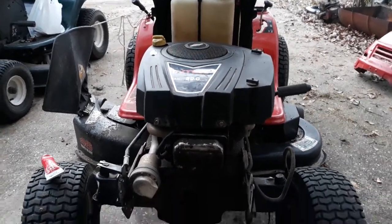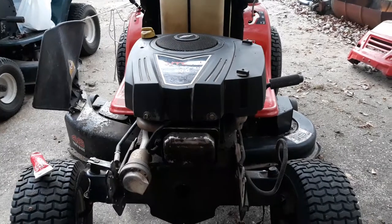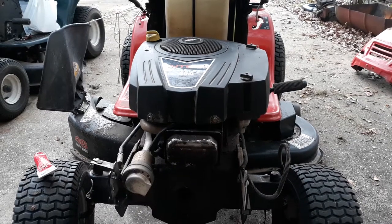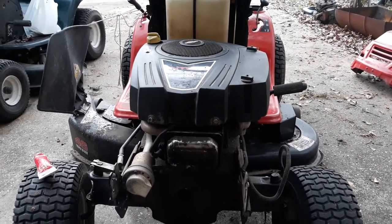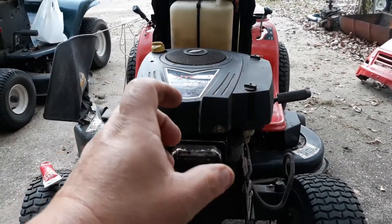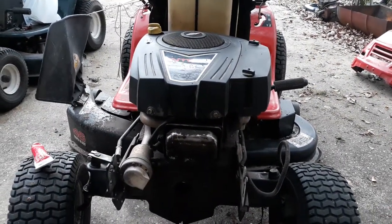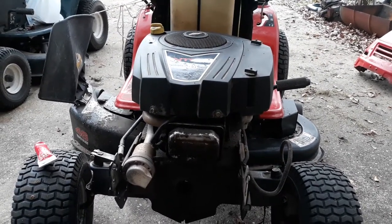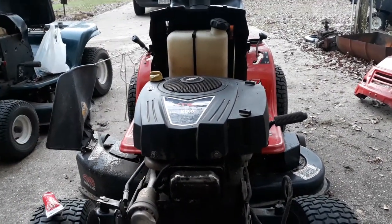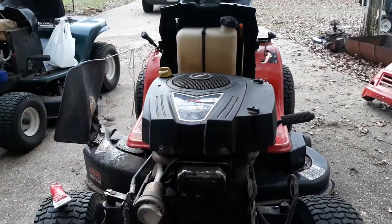The motor was actually the most work. When I got this lawn mower the engine didn't run — nothing free is ever actually free. The day I realized something was severely wrong was when I took the valve cover off, pulled the rockers off, and pulled out the aluminum push rod — it was bent. That told me something was severely wrong, but I got it running long enough to confirm the transmission and everything else was still good, which made it worth messing with.